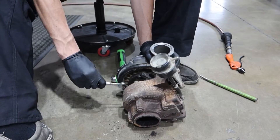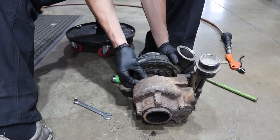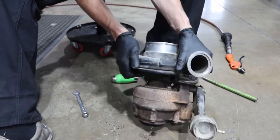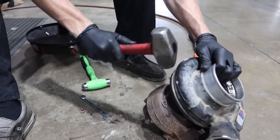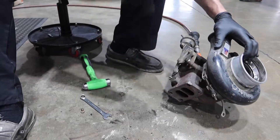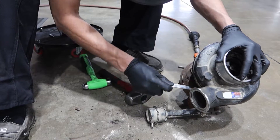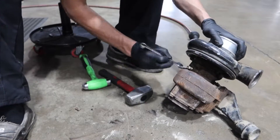We're getting rid of our 21cm H1C housing, so this should yield much better spool-up and better manners overall. Everybody always claims this is a complete 100% drop-in swap, whether you just swap the 12cm housing or swap the entire charger and put an HX35 in it. Whether that's true is debatable — things do need to be slightly modified in my opinion, and that factory downpipe is junk.